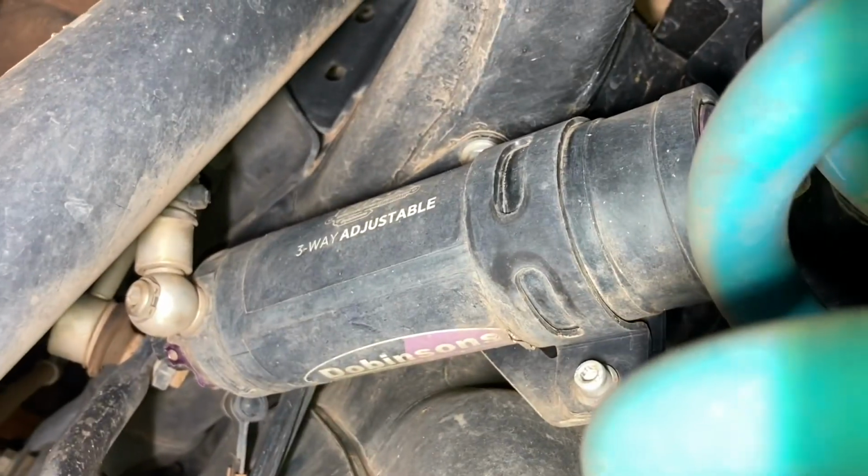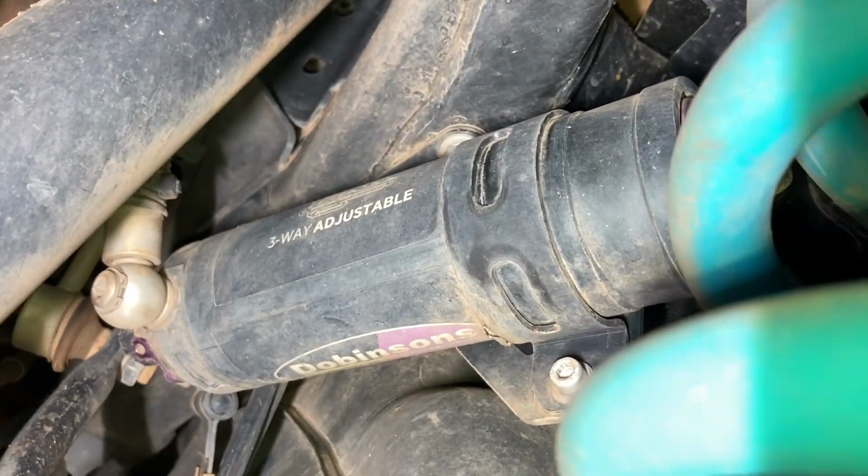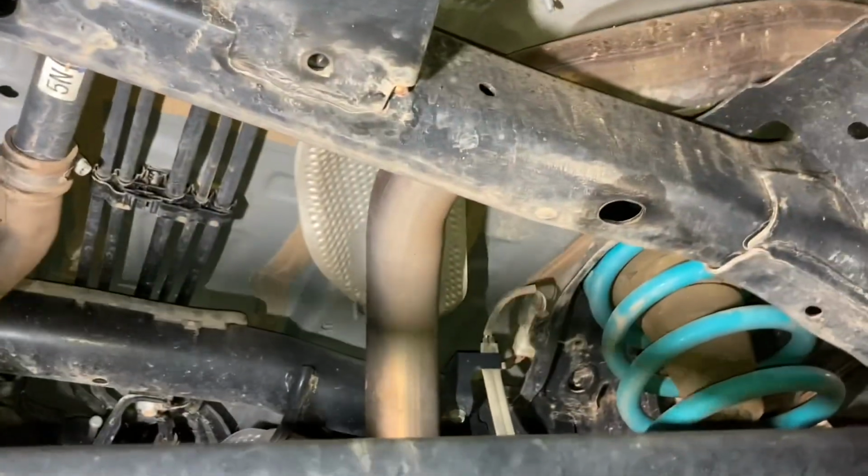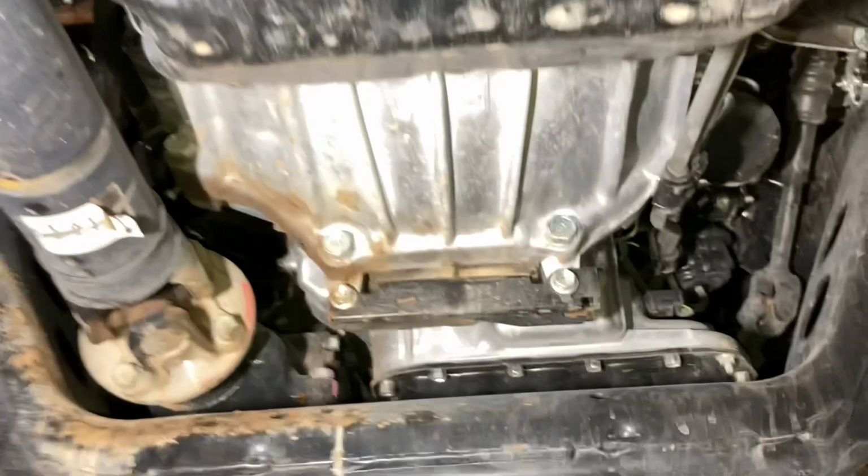And the other thing you've got to check is on the adjustment, the little hex key screws, that they don't come loose. You also got to check your brackets, because with the whole canister shaking around, the brackets can break, all sorts of things. The more mechanicals you add to a vehicle, the more unreliable it can be. So we're testing it out, but you just be very careful with that. Everything looks really clean still. I can't see any abnormal leaks or deterioration.